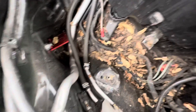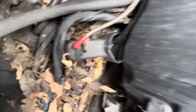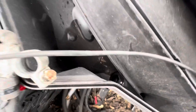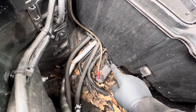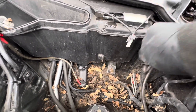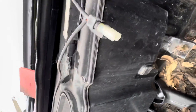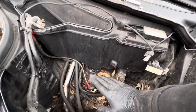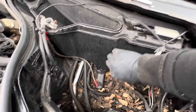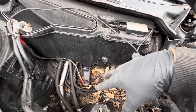With the battery tray out I can show you the mess underneath and why it's so important to clean all this out. We found the positive cap — great, so we'll put that back on the battery. You'll see this is the air intake for the interior cabin air — that clicks in there and drains out the hole in the bottom. That drains into this collector here. If this collector gets blocked with all these leaves, it backs up, and where it seals to the body — there's a seal all the way around this air box to the bulkhead — this fills up with water and slowly seeps into the cabin. You also want to make sure this drain here is clear.